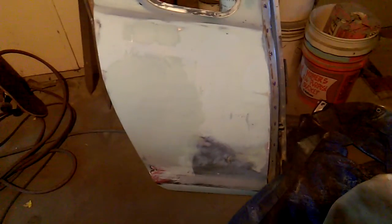I did my best trying to hammer and dolly this big section here by trying to come through the back, and I just kind of got to a point where it wasn't going to get any better, so I just started pounding down the crown of it, roughed it up with some 50 grit, and then went right to filler.